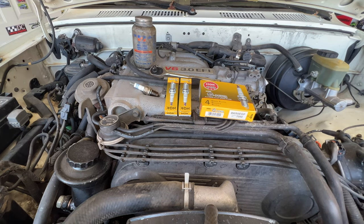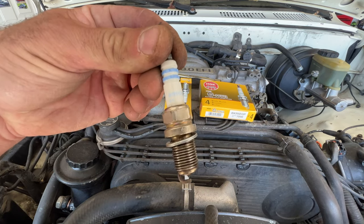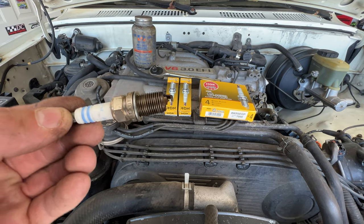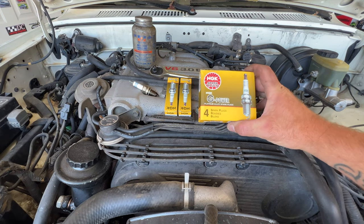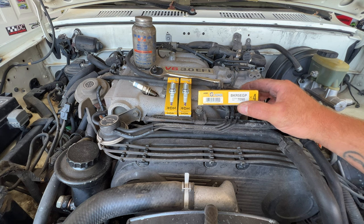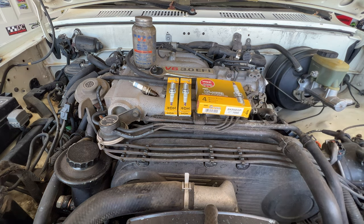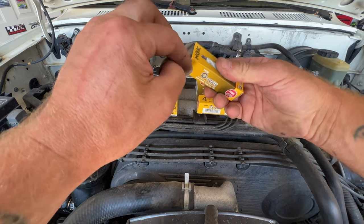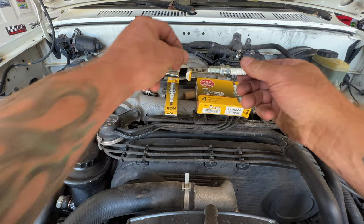All right, guys, let's go ahead and take a look at our old and new plugs here. So you can see the old ones were a Bosch Platinum, and they really don't look too bad. But I'm gonna be replacing them with these NGK G-Power Platinum plugs, part number 7090. Got all 6 of these off of Amazon. I'll put a link in the description. So let's go ahead and just take a look at one. And these do not come pre-gapped, so you will have to gap them.